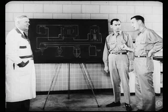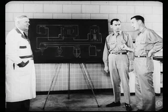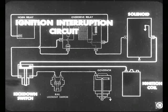Why from the ignition terminal and not the battery terminal? We take current from the ignition terminal so that we can get current into the control circuit when the ignition key is turned on — that's to eliminate the chance of a leakage of current due to a ground in the circuit. Now let's look at the ignition interruption circuit: it starts at the ignition coil and passes through the B contacts of the kickdown switch to ground in the solenoid.